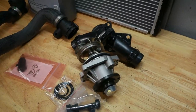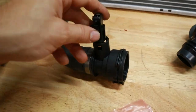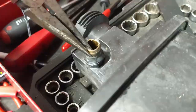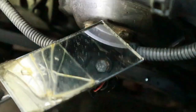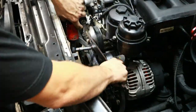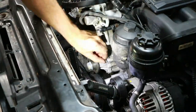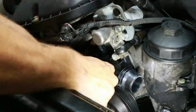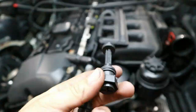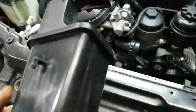Now we move on to the M54's main weakness: the cooling system. It's not really the cooling system itself that's the weak point — it's the fact that because this is an all-aluminum motor, the first time you overheat it, it's going to warp the block and probably the head as well. You'll suffer head gasket failure really easily if you ever overheat this engine. So the best thing you can do is take care of your cooling system before it fails — change out your water pump, thermostat, radiator, and all hoses that look old or original, because you don't want any of those to pop.